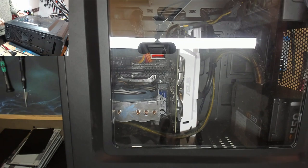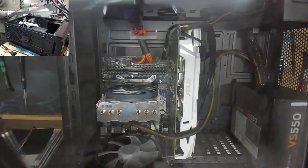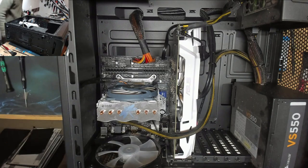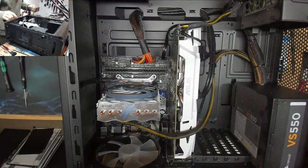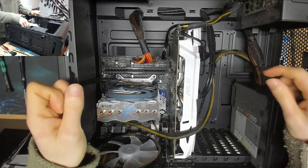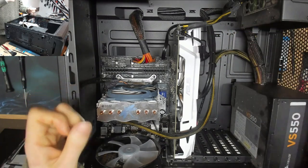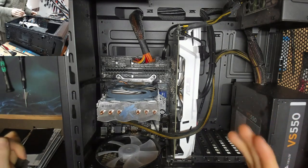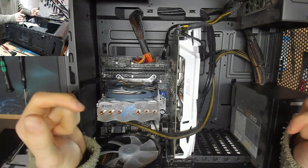Got a PC specialist build here, which has no post. And that's not new due to any defect. Client did a CPU upgrade on it, new CPU is not working. So they've dropped in an i5-9600K, and it didn't post. And that is fairly predictable. Presumably the motherboard doesn't support it, or the BIOS doesn't support it, or something like that.